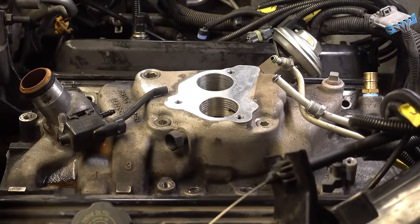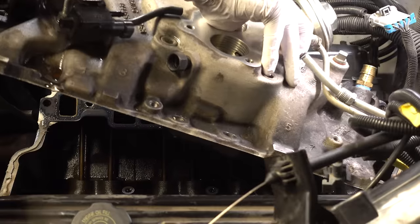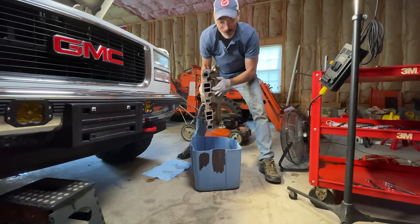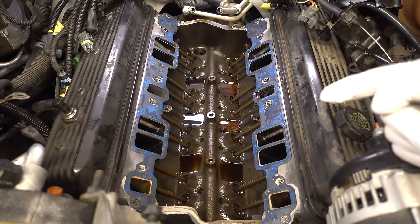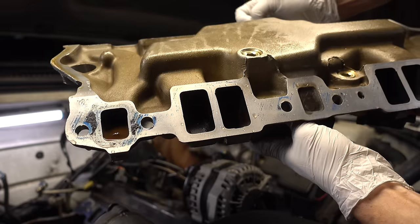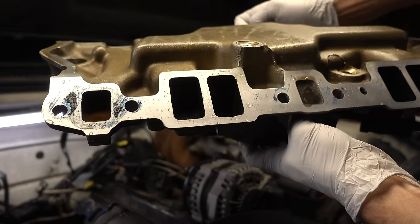Let's see how hard this is to take off. Not as hard as before. These are brand new gaskets just installed a few weeks ago, and it looks like most of it stayed here on the head. I'm really hoping that these come off in one piece and there's not a lot of scraping to do. Looking at the manifold side, you can see that for the most part the surface is nice and clean. There is a little bit I'm going to have to try to scrape off, but nothing like it was with the original gaskets.